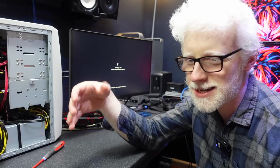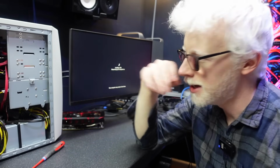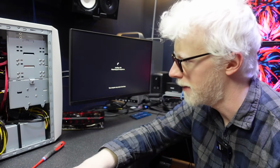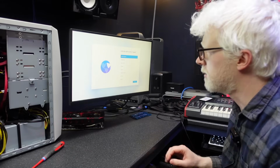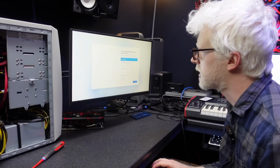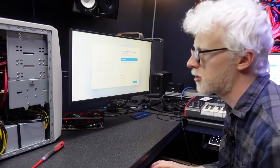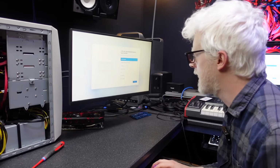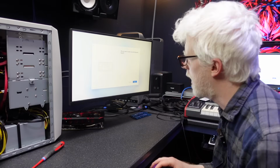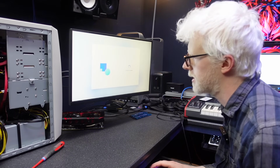But maybe once I get a stable install on this drive, that will at least alleviate all of this install nonsense. In fact, I'm going to research how much power the R9 380 is meant to consume. That might be a big help, and then I can kind of compare the cards. Okay, so the power consumption seems to be pretty much identical between them. There's only a 5-watt difference in the rated max power. So apparently max power of RX 580 is 185, and the R9 380 is apparently 190. That's max power, but they're kind of handy figures to look at because the power may spike. So I'm working from max figures, even though the card is pretty much idle when doing things like this, obviously.